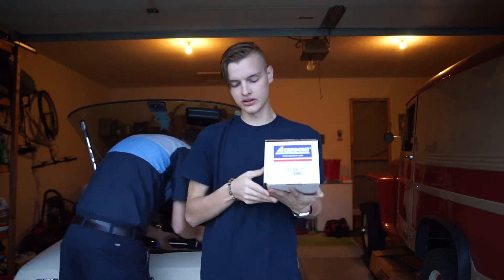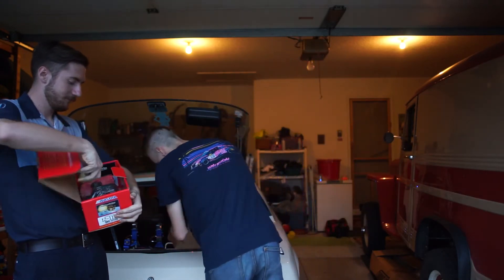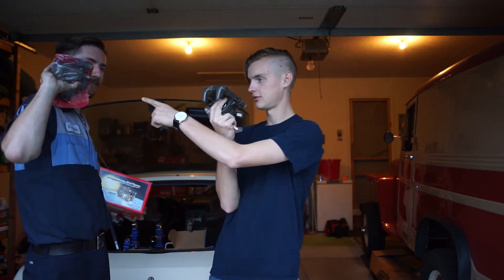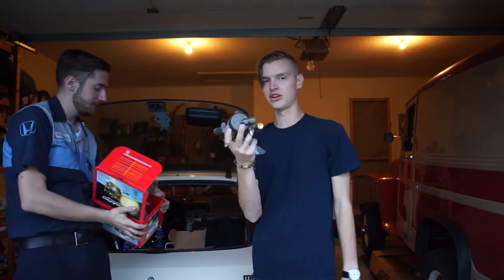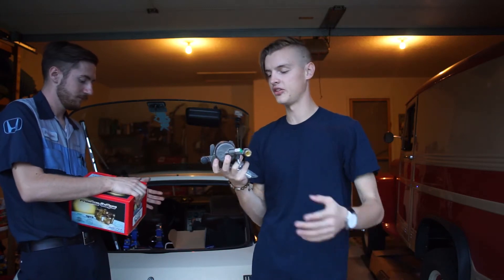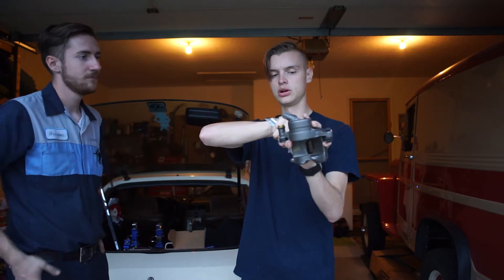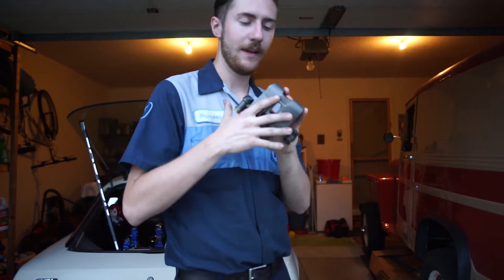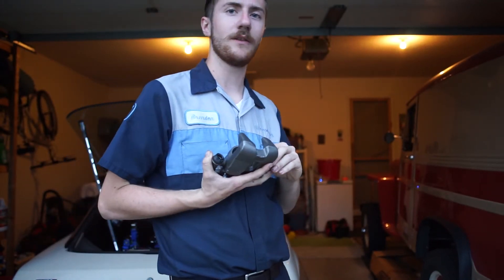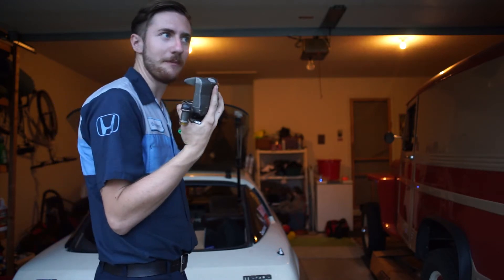On the list of parts: we couldn't get the brake lines out of the factory calipers last time before Autobahn, so I picked up two rebuilt front calipers — nobody has rears right now. Basically, somebody sends in an old caliper core and it gets rebuilt with all new hardware, new fittings, new covers, and a new piston. They're not replacing the cast part of the caliper — that's where the big production cost is. Rebuilt calipers are just as good; it's a factory caliper that's been sandblasted and everything that usually wears out has been replaced.